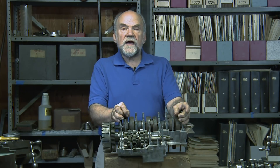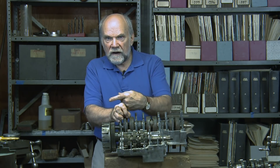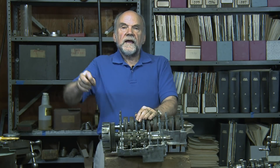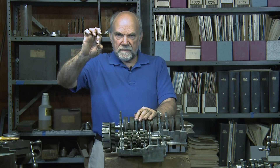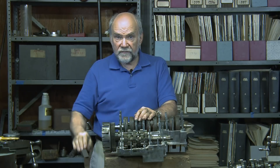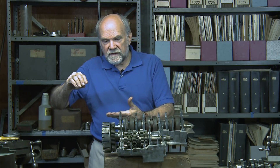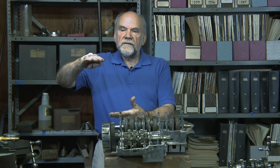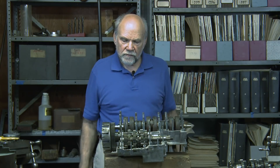The reason for that is that the driving force is applied at ground level by the back tire, and the mass of the motorcycle acts as if it were concentrated at the motorcycle's center of mass, which is somewhere 20-22 inches above ground. So the combination of force acting at ground level and the resistance of the mass of the machine being at a higher level means a torque is created that lifts the front wheel off the ground.